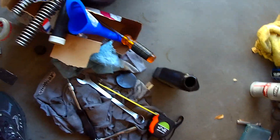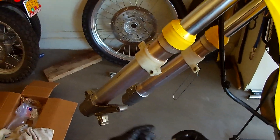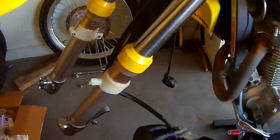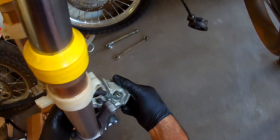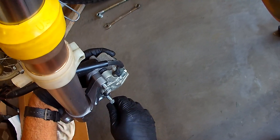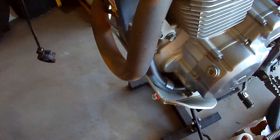So we got bolts, and we got a brake caliper. I didn't let it hang and sit there — I know it puts stress on it. I just fit it right here on the ricochet skid plate, so I wasn't stressing my brake lines or anything, because stress on brake lines results in a lot of horrible things. I didn't stress the brake lines by doing that. I was going to get a motorcycle tie-down and hang it from that, but it fit just fine on the skid plate. So if you've got a skid plate, that works out pretty fancy.